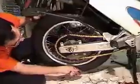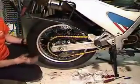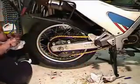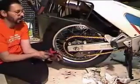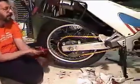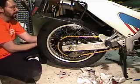So we have the chain on, and so now we need to adjust it. So you can see there's a whole lot of chain slop. So what I'm going to do is tighten it until the washer doesn't slop around anymore. I don't want to be able to slide the axle around, but I do want to be able to move it. So I counted the turns when I took the wheel off, and if I hadn't replaced the chain, I would just count them to go back, and it would probably be maybe a half a turn or a turn more. But in this case, let's just do half turns: half 1, half 2, half 3, half 4, half 5, half 6, half 7.